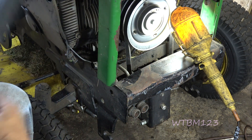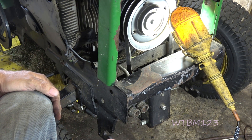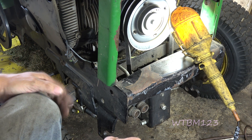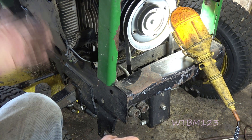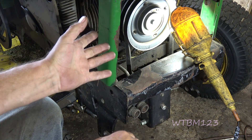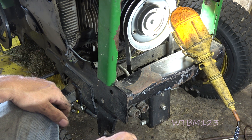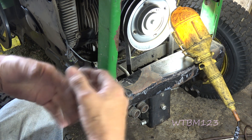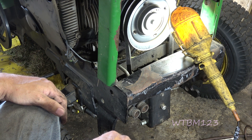Most of these clutches need 13.2 volts or higher. So when your charging system doesn't work, or you're having to mess with the battery every time you start it, you don't get full voltage to the clutch all the time and it'll actually cause micro slip. It's not going to make your clutch go out that day, but it could shorten the life of that clutch by half or whatever — it could take it away.